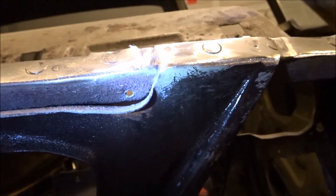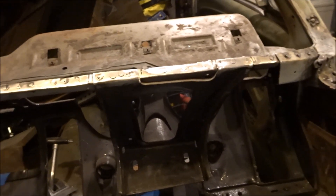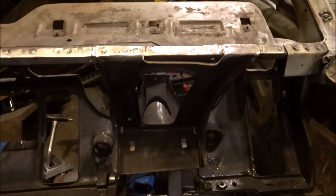My plan now is to clean up a little bit more, then hit it with some weld-through primer. You can see down in here it's a good opportunity to treat this metal. I had sprayed it before with weld-through primer, so I'm going to do that now. I've got the can inside warming up — it's 50 degrees in the shop and I like the can to be a bit warmer, as that's essentially the minimum temperature for applying weld-through primer.